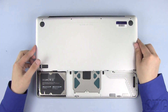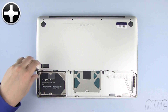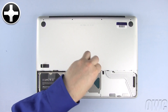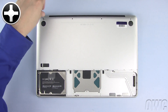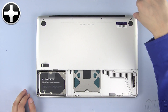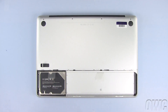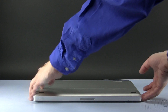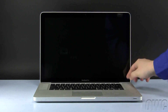Align the bottom of the case and set it back into place. Reattach the eight Phillips screws, making sure that the different length screws are in the proper location. Set the battery back in place. Finally, set the battery and hard drive cover in place and lock it in. Your OWC data doubler and second hard drive are now installed. Turn your MacBook Pro over and turn it on.